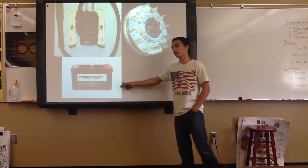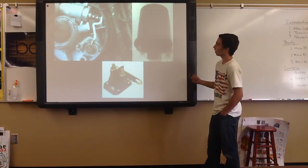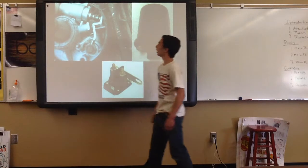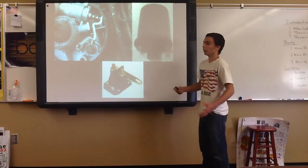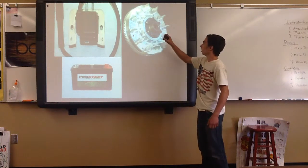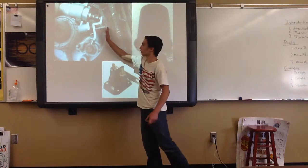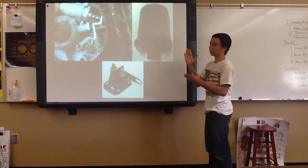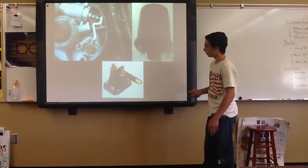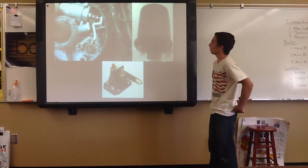Make sure you've got a good battery — that's important because most riders have an electric starter. Not all small engines have points, but what points basically do is when the flywheel turns over, the points will open up and every time they open up it sparks, then closes back and keeps going. You have to make sure they are clean in between to make a good connection, or else it's not going to run and it's not going to have any spark.